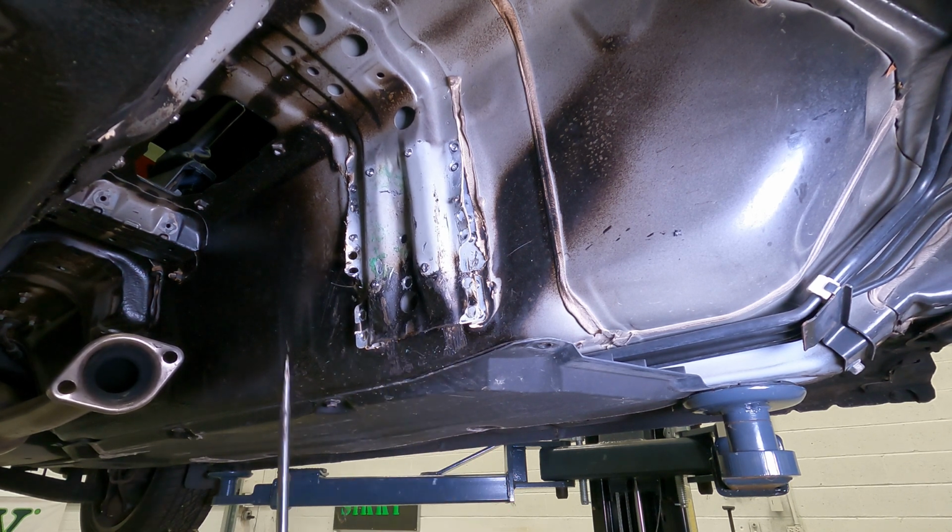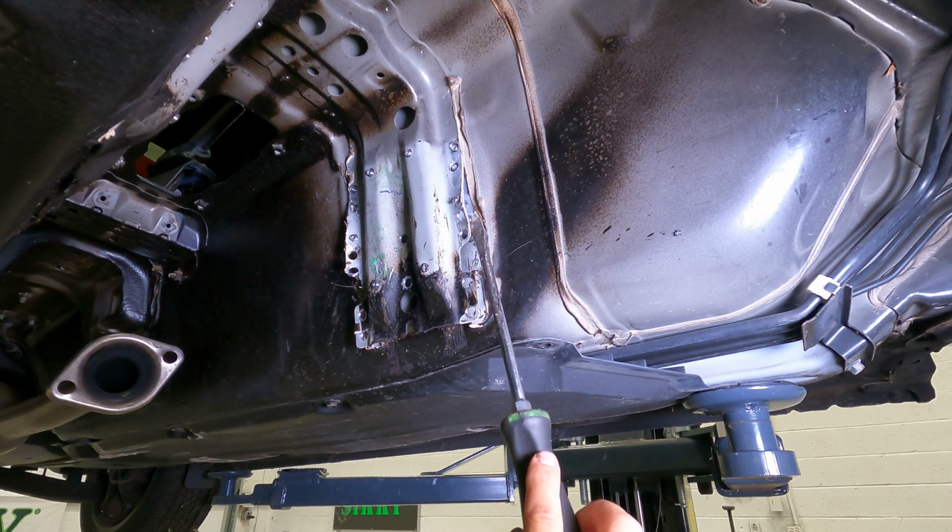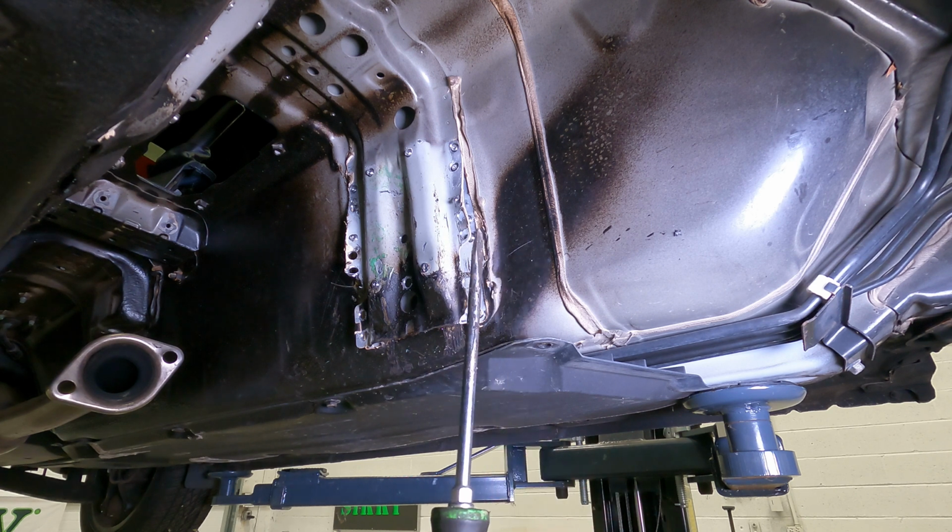You can see all these are free now, all the way down. That popping sound is actually a good thing. It means you didn't drill all the way through this layer. You're breaking a real thin layer at the end here, which means you're not gonna have anything to fill in or whatever. You're just gonna grind these nubs off and then be nice and flat.